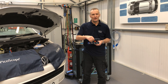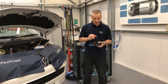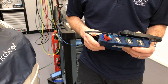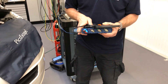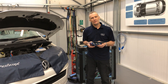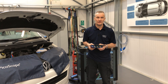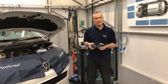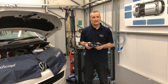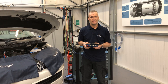Moving on with BNC plus, extending to current clamps — here's the new 2000 amp clamp from Pico. The shell is blue and red, and when we connect BNC plus, the shell indicates blue for the top half, red for the bottom. The real win is that there's now power delivered to the clamp via the scope, so no issues with batteries going flat within the current clamp during prolonged measurements. Setup is easy, software recognizes it's a 2000 amp clamp, sets the probe accordingly, and zero offset is taken care of on connection.